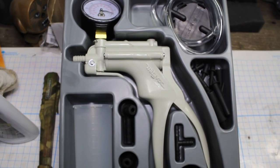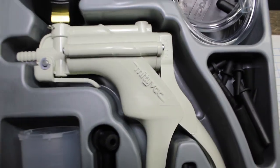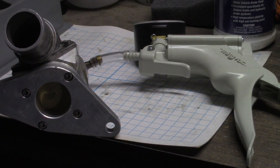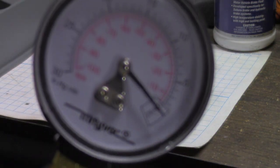The MightyVac is a really great kit and you can't beat it for the price. It was around $35 at the local AutoZone and it's going to come in really useful because it can test any type of vacuum-actuated device like blow-off or bypass valves. You could also tune them with your springs because this will do about 15 psi.